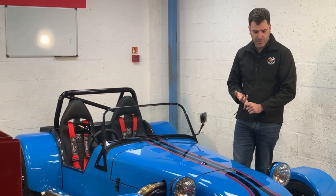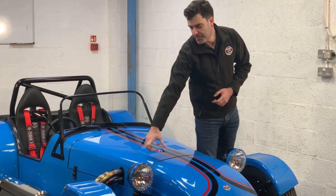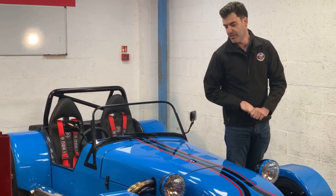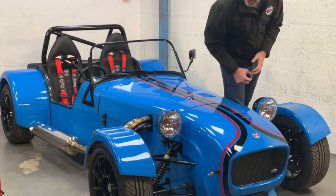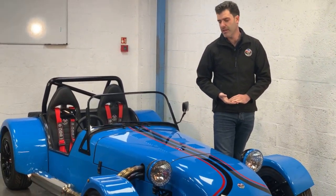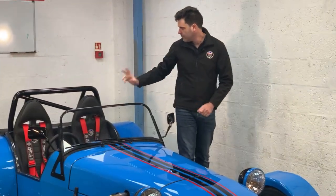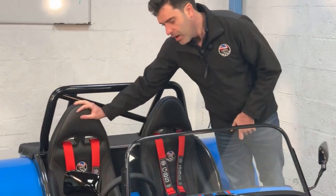This particular car, we went with the ATR shock, which is our own alloy monotube damper that we've designed for the Zero and other cars, but the shimming is tuned for the car. Went for the daytime running lights, and he's got our brake kit on as well, which is the 4-pot 300mm floating disc brake upgrade. Went for interior red stitching, so stitching options on the seat, or whatever you want.